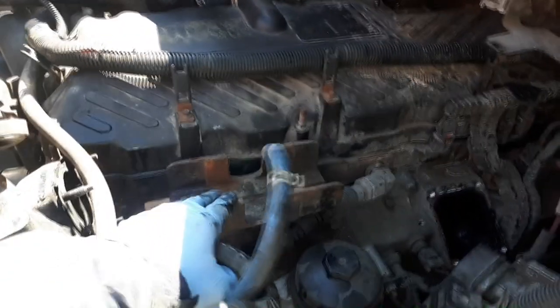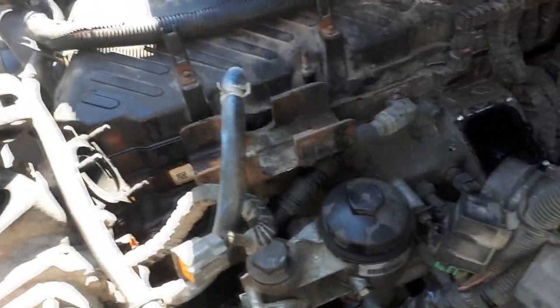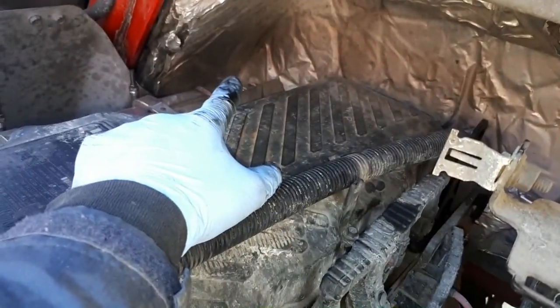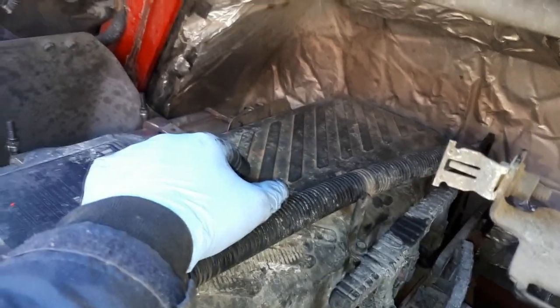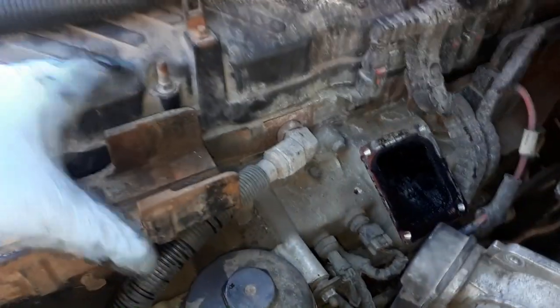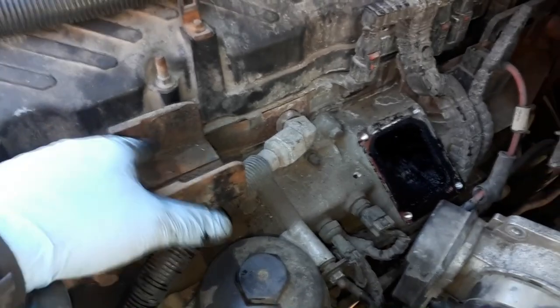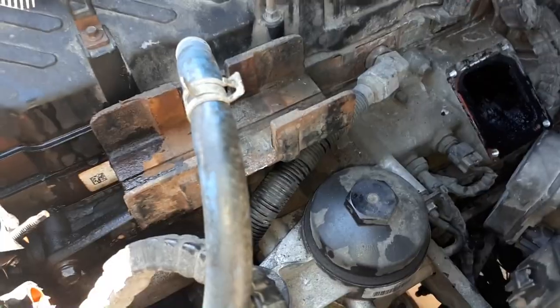I've removed the cold side EGR cooler — this was the easy side, in my opinion. That other side was very difficult, especially those three bolts, and lining them up with the exhaust pipe again is a little hard. The bracket on that side was very rusted. This one doesn't look too bad. But when you put the new EGR cooler back in, if it's too rusted it won't fit, so you're going to have to clean it up and grind it out — that's what I had to do to make it fit again.